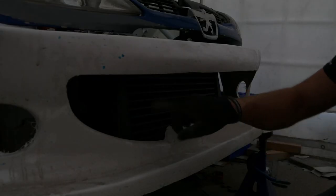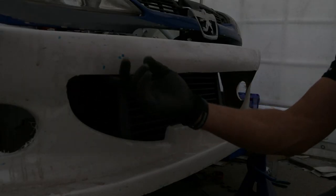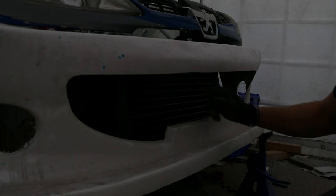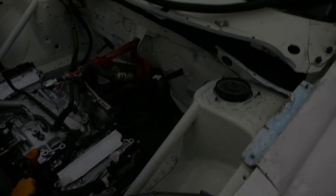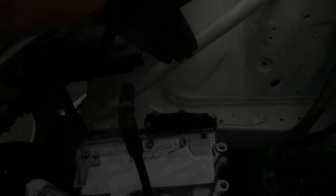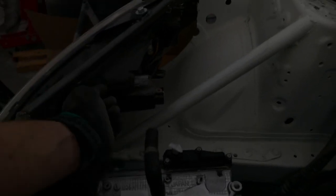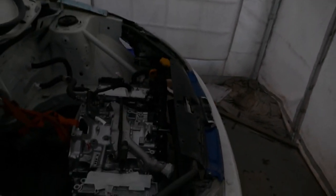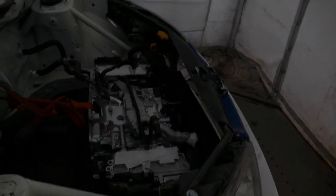You can immediately see the benefit of making this front grille much higher. I have taken 15mm off this lip, which will give me extra airflow to the intercooler. You may be wondering how I will run the intercooler pipes as there is very little room at the front, but there is good clearance underneath these front stays. It's set up in a convenient place where the inlet and outlet are on either side, literally where the front of the chassis leg is, so it will be a nice short pipe to curve up and around. One of the next jobs will be to get the bonnet on and see how much clearance we have for the inlet manifold.